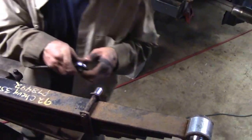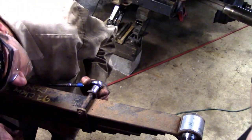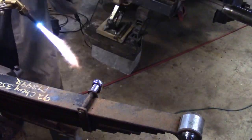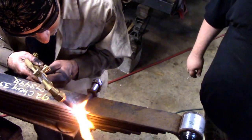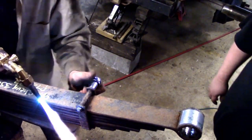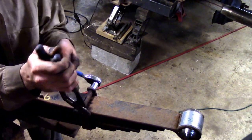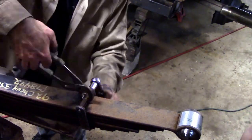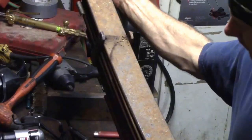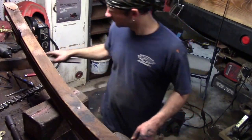This is on an 88 one-ton Chevy dump truck. Here you can see us taking off the leaf spring holders — the clips that hold the end of the leaf spring together. We heat those up and get them all off. This leaf pack is already one leaf bigger than the one that was on it, because it came off a newer truck. We're taking the overload from the old leaf pack and putting it onto this one. The original pack came without an overload but had an extra leaf spring, so this makes it a stiffer setup overall.